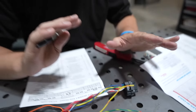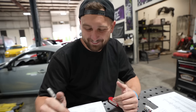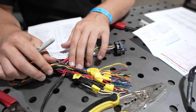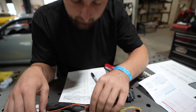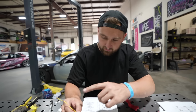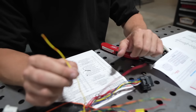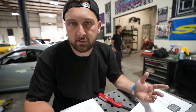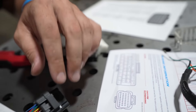Next I'm going to remove things we're not going to be using anymore — AC stuff, check engine light — just to make things simpler. For the tach output signal, it'll send a signal to Brian's factory tach, which the tach is going to be controlled by an AUX in the ECU. We need to find an open AUX on the list. We'll start with AUX one and pin it in there. Make sure you write down where you put everything, so when we define in the ECU we know where everything is.